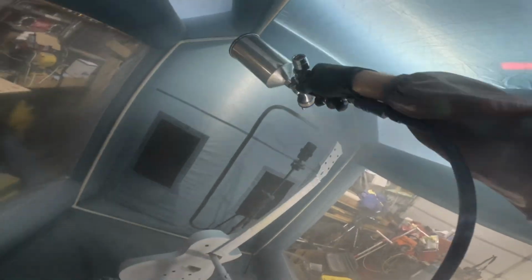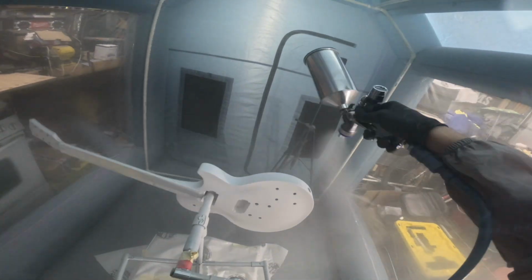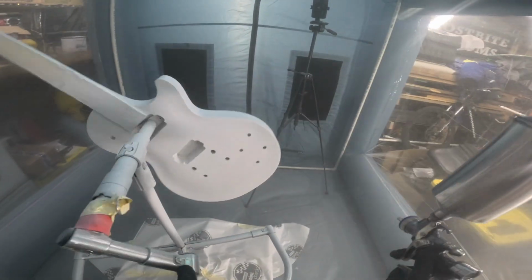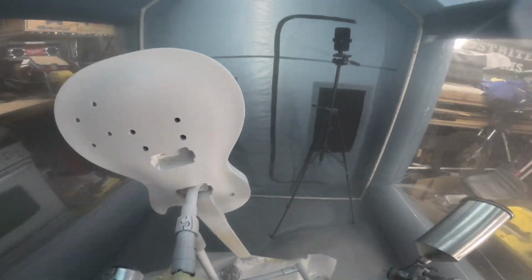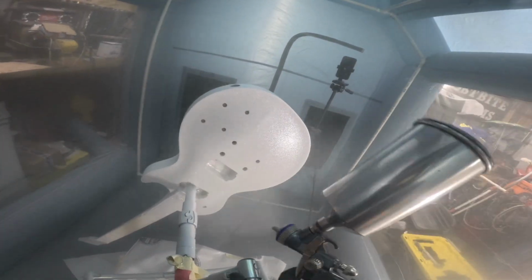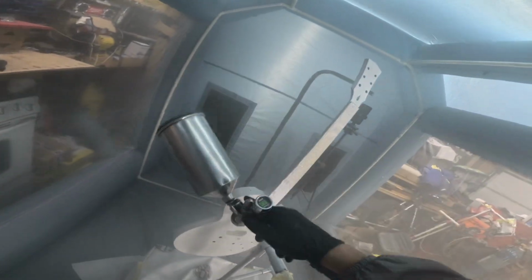If you've painted before, I'd sort of describe this almost like doing an orientation coat for metallics. I'm just trying to get a nice even coat over everything. I don't want it very thick. I just want those metallics to land on the surface and land nice and evenly. And I'm not trying to go thick, because if you do spray too thick with a flake or anything thick like this, it is going to sag, and you will notice that in your color.